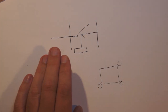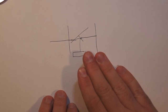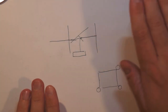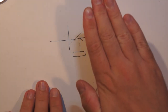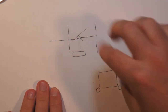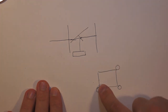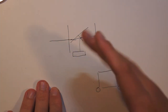When I modified the D80, I had to retune the autofocus sensor, and I did that mostly by fidgeting with it. I don't have a precise method for doing it, but I started out with a center AF point, and you adjust that until it comes into focus, and then you start looking at tilt in one direction. So first you set the center focus, and then with the two screws, you tune the tilt in the lower right, the upper right and the lower left corner so that your sensor is in plane along this axis, and then finally you tune the last axis.